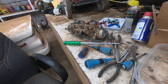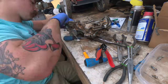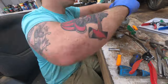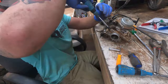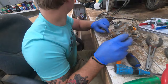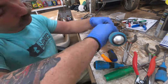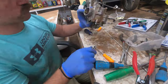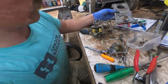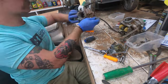So if you watched my last video, you know about JIS screwdrivers. Those blue-handle screwdrivers I have are called JIS screwdrivers — they look a lot like a Phillips but they're technically not. A lot of these Japanese motorcycles don't use true Phillips; it's called JIS, or Japanese Industrial Standard. If you work on these bikes or lawnmowers pretty often, I would really recommend getting a good set of JIS screwdrivers. It's denoted by a little dot on the screw so you can tell the difference from a regular Phillips. If you're stripping a lot of Phillips heads, it's probably because it's actually a JIS — the right screwdriver can make all the difference.